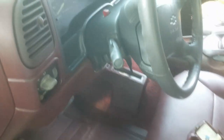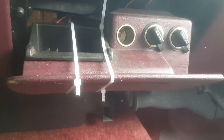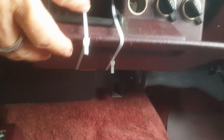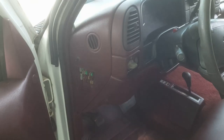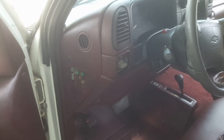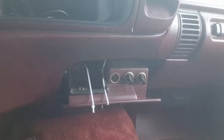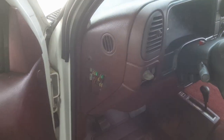I'm going to do some checking around because this deal over here is concerning. That's the cigarette lighter and the ashtray assembly, which as you can see has been broken somehow back in there and it's just kind of hanging loosely. I'm going to take my meter and check to see if we've got ground anywhere. If it's not grounded out, then I'll go ahead and try a fuse and see if this gets anything going, because it could have just been somebody overloading something — or something was dropped in it, like a coin.